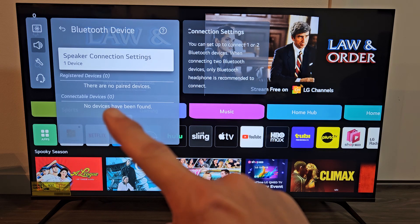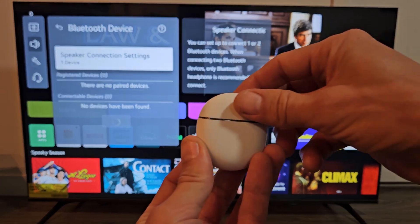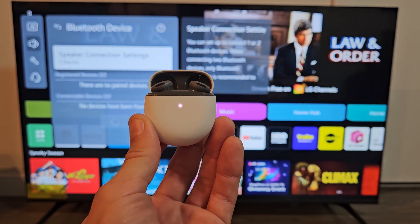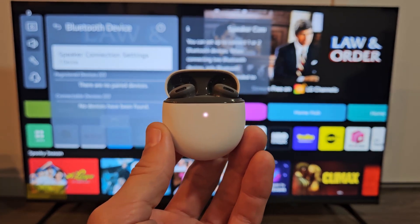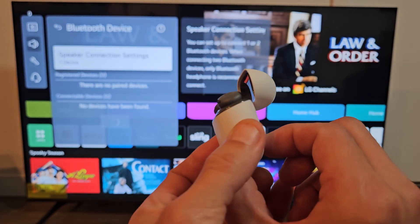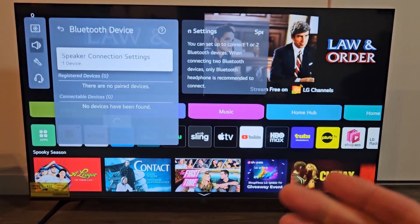You can see it's spinning right there — it's searching for devices in pairing mode near me. So let's hurry up and put these in pairing mode. The buds are currently in the case — let's open these up. You'll know this is in pairing mode if the light is blinking white. I'm not getting a white blinking light; I have a solid white light, because I'm already connected to one of my other TVs or my phone. So let me manually put this into pairing mode. There's a button on the back — press and hold that button until you get a white blinking light. It's blinking white — now we're in pairing mode.